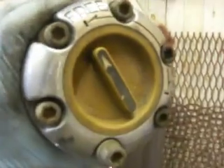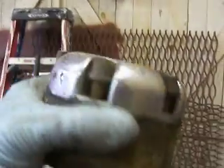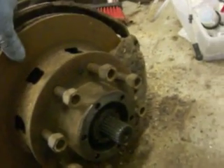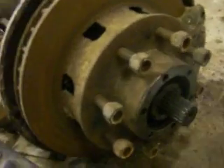I took these off a Blazer that I sold before YouTube. I had an '87 Blazer from a guy that had put one-ton axles on it. I removed the hubs, and in place of those giant hubs I put on locking hubs. This is a full-time four-wheel-drive Blazer — 203 transfer case with a center differential that lets you run it in four-wheel drive all the time. A friend of mine put them on the so-called three-quarter ton / one-ton Blazer.